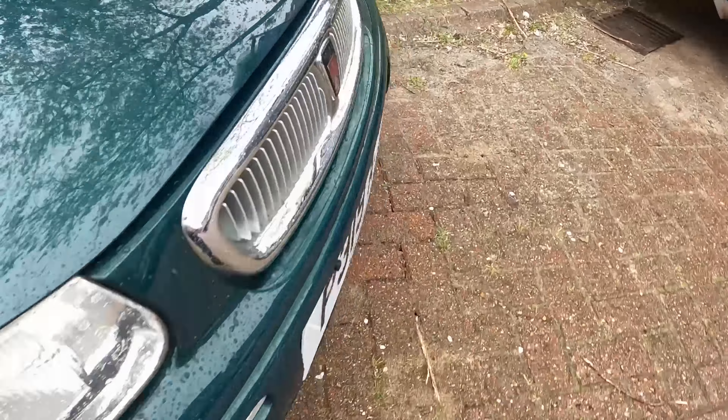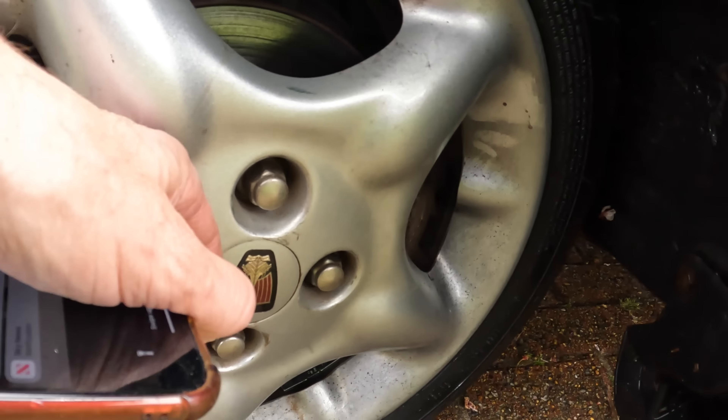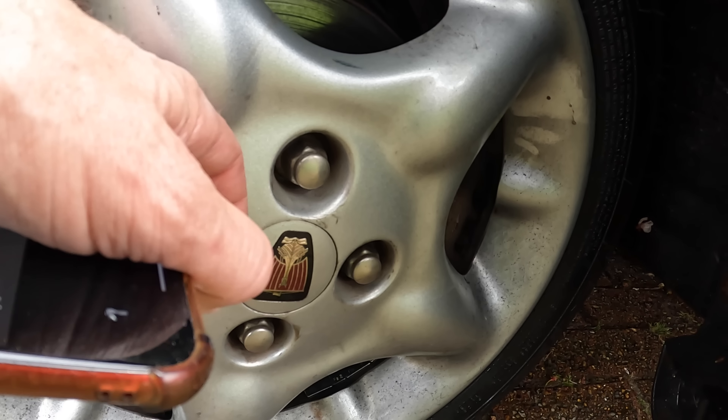On the test drive to see if that's made any difference - don't forget, after any brake work before you leave the drive, push the brakes a few times to make sure they're working again because the first couple of stabs are often nothing under your foot. Important safety tip. I'm anticipating people saying the car is pulling left because that brake was snatching, but the brake doesn't feel like it's snatching and it is still pulling left, so I'll need to get the tracking done very soon - I've got these lovely new Falken tyres on there and I don't want them scrubbed before I've driven the car any miles. Nice and cool, barely feel it to the touch. Passenger side is a tiny bit warmer but it already was. I'll call that a win for now.